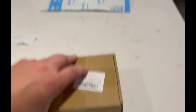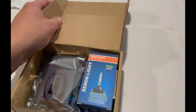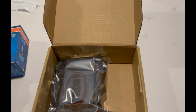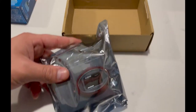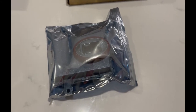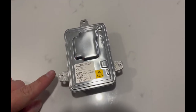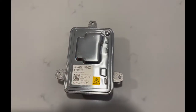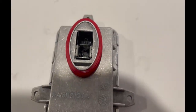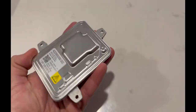So this is the product I ordered from Amazon — came shipped in a little bag. I don't think it is an OEM product. Oh, it actually came with a bulb too, which is kind of cool, but I shouldn't need it because my headlights work. So this right here is the light ballast that we will be replacing today. I will need to remove my bumper, and I'll show you how to do that on a 2014 Mercedes-Benz CLA 250. Right off the bat you can see it's simple — three screws, gonna be mounted on the bottom side of the headlight. It's just a simple plug and play: you plug that part in and screw it in. Make sure your gasket's nice and tight to keep moisture out and that should be it.